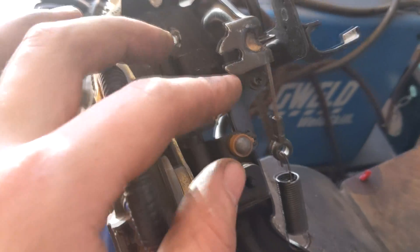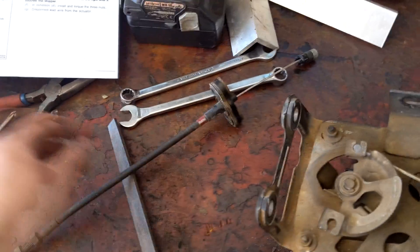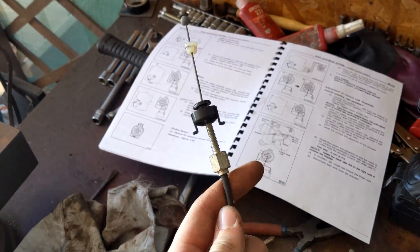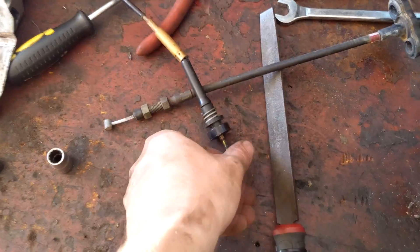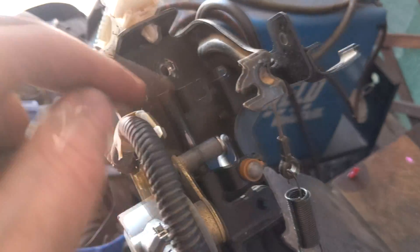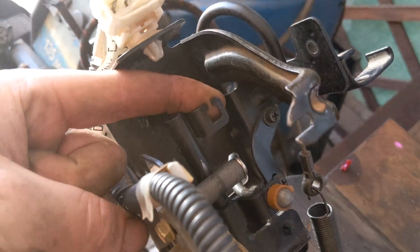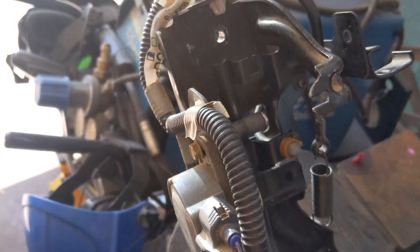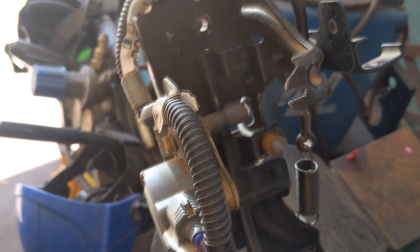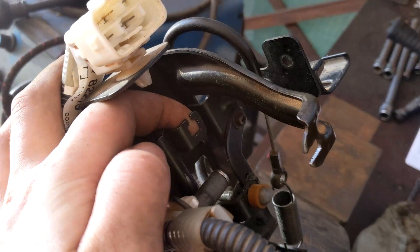I'm going to join it where the idle up usually goes. Usually on cruisers, you have an idle up cable, which is this one here, and it goes to like a little turny dial on the dash - you can lock it and idle it up. So what I'm going to do is fit it to that. This is the throttle pedal. You can see if I'm going to activate this pedal - I'm clamping at the moment so it doesn't move too well - but we're just going to go on that little hold there.